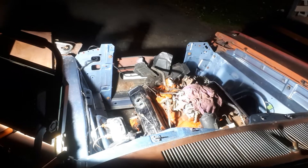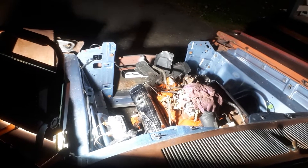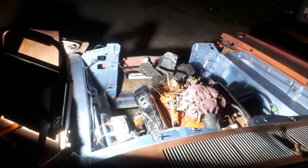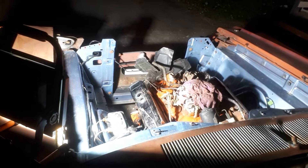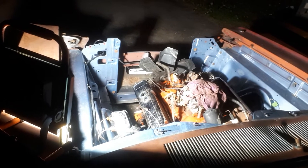She's tight. If you're building one of these cars and you plan on keeping it, I recommend leaving that upper rad shroud not welded in — bolted in — because you can take that out and roll that motor and transmission in nice and level. Makes things a lot easier.